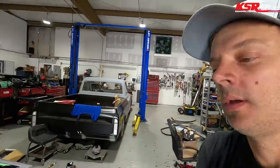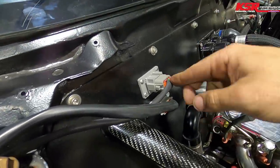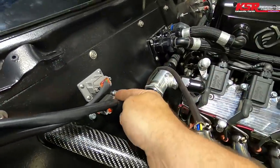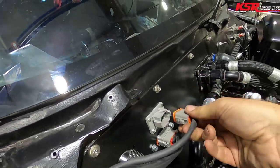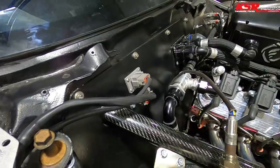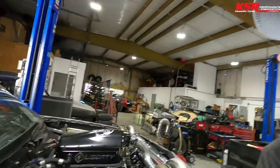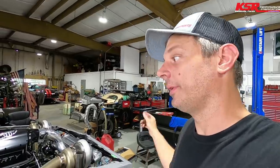Travis made a huge step today in the remainder of the wiring. So these plugs here, kind of similar to our injector plugs. In fact, this bottom one is the same for the headlight plugs. But if we want to take the front end off, take the hood off, take both of those loose, they'll be kind of bundled up together. And then that wiring will come out with the front of the car, the headlight wiring, the horn, the humidity and temperature sensor that's at the very front of the car. All of that will come off with the front end of the car. And then when you plug it back on, plug the lights back in, they all work really good.